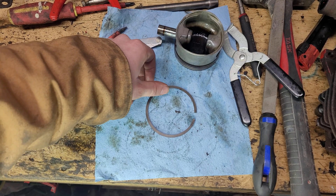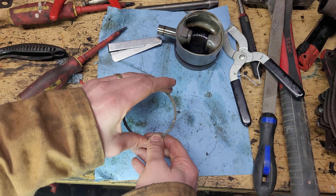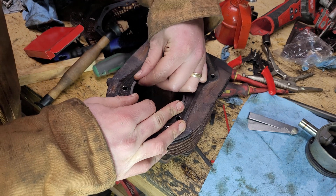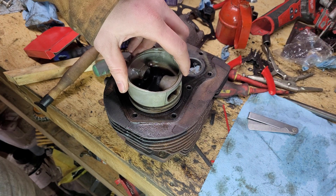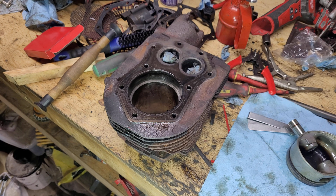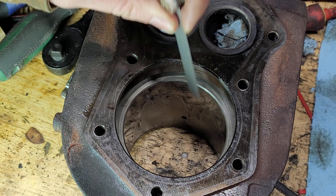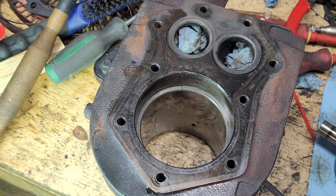So it's finally time to start putting parts back onto this motor, and we'll start with the new rings. These rings, like most, need to be ground down to fit my bore and piston. The specs for this motor are 10 to 32 thousandths on a used bore, or 10 to 23 thou on a new one. So here's how it goes: take your rings and place them into your bore, then use your piston to push them into a place where the rings would normally contact during the stroke of a piston. You can't leave them at the very top or very bottom of the cylinder because the rings won't actually touch there during a normal piston stroke. With your rings pushed down flat — I'm using a wrist pin here to make sure my piston is pushing down evenly — you can measure your gap. At the moment I have next to zero ring gap, so I'll remove the ring, file one side of it a small amount, and then recheck. After a bit of filing, I have a roughly 13 thou gap, which is perfect. I'll repeat this for both compression rings, toss them along with the oil rings back onto the piston, and then turn my attention back to the cylinder.